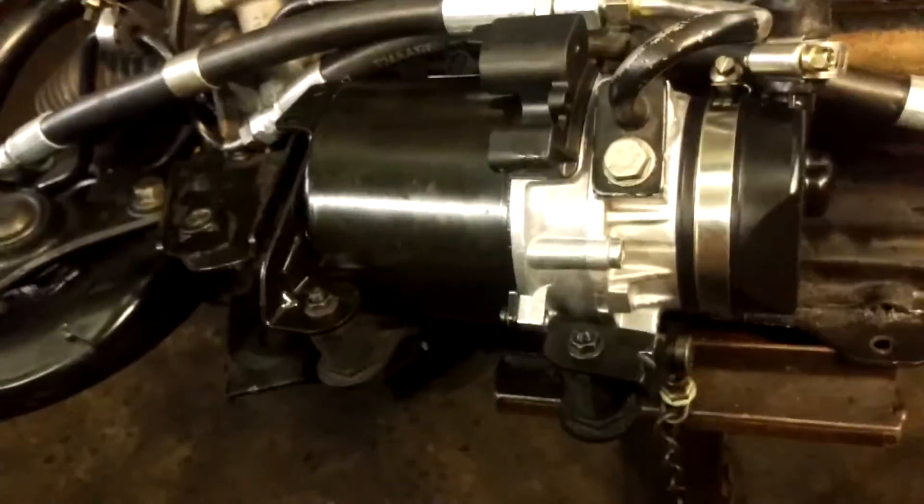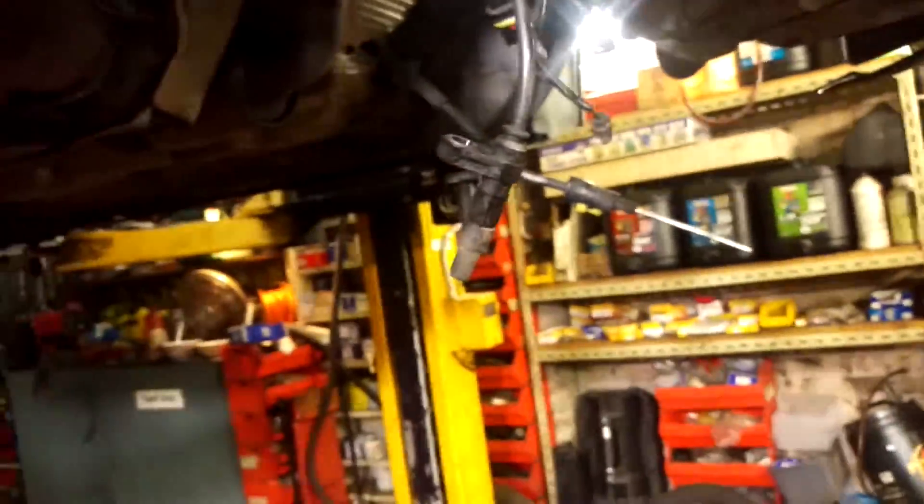This is what they're also famous for — most of them have an oil leak from the front of the engine. This one had a crack in the sump, so we've used some Permatex liquid steel. Check all your connections; there's the oil filter housing. Those are the fan connectors, that's the automatic transmission cable — very fragile. When working on Minis, always remove the ABS sensor because they just fail.